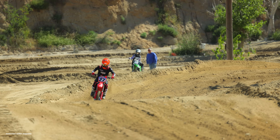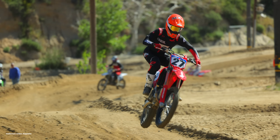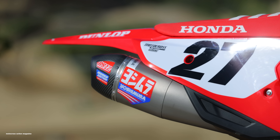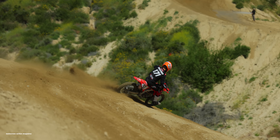Last year's bike hit 60 horsepower on the dyno, and I'm expecting this one to be in a similar range since the 2023 engine mods didn't affect peak horsepower dramatically. It also hit 37 foot-pounds of torque on the dyno last year. It's a big difference from the stock bike, but because of the mapping and the smooth Yoshimura exhaust, this bike is still very rideable — not blaring out of corners ripping your shoulders out. It's still a smooth bike. I raced the Honda last year at the Pala National and I'm planning to race this Honda at the Hangtown National in about a month and a half.